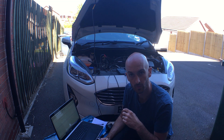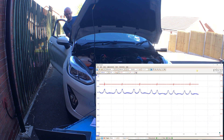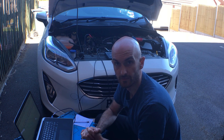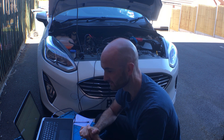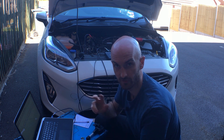We've whipped the plug out and we'll have a look at what we get now - you'll definitely be able to hear this. We can see there that we've got two peaks and one missing. We've got cylinder one identified by the coil signal and then a peak missing, which suggests the firing order of this engine is one, two, three. If you've got an engine that's blatantly lost compression on one cylinder, this is a really quick check just to confirm which cylinder it is - especially helpful on a V8 or V6 where you could be looking at taking the head off one side or the other.